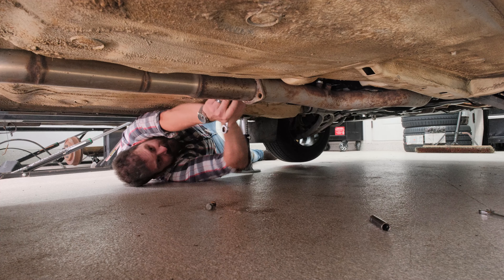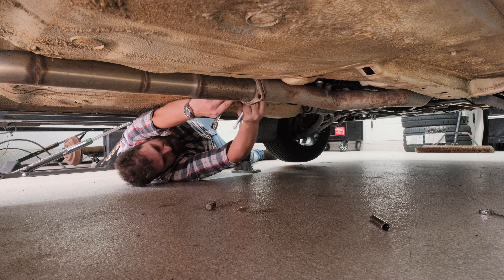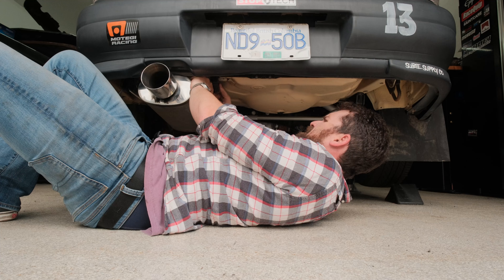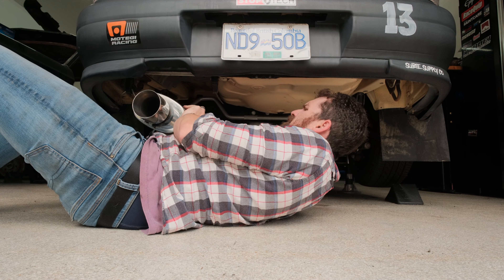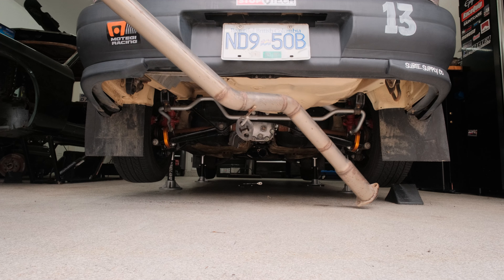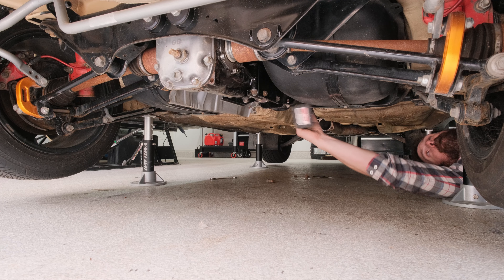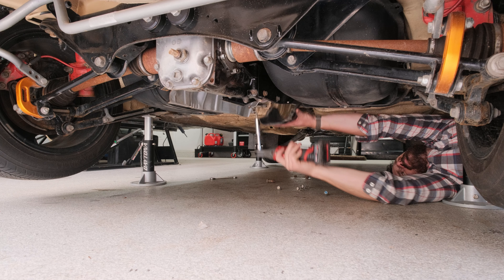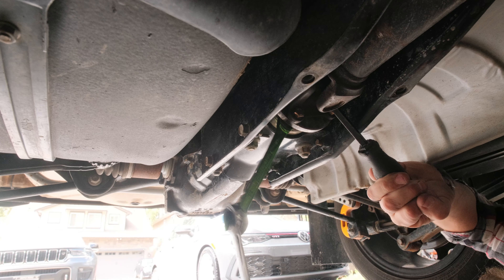Flocking the dash is all done for now. I'm going to crawl underneath and disconnect the exhaust with the downpipe, slide it out, and then start working on getting the drive shaft out. After doing some research, I found out that pinion angle can make a difference in vibration and harshness in these cars, even though it is a two-piece drive shaft. I wanted to inspect it, so I did take out the exhaust — it was coming out anyways. Then I worked at taking my skid cover off and getting the drive shaft out to get my digital angle gauge on and see where we were at.